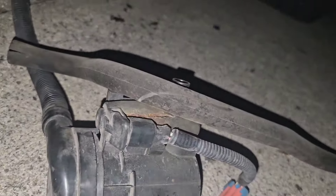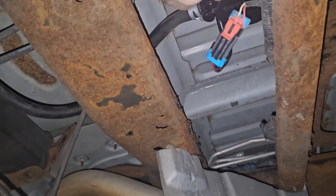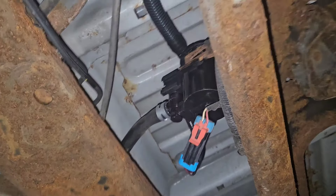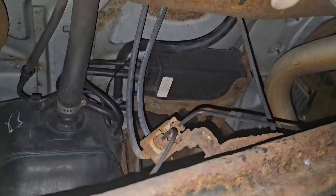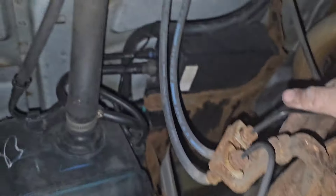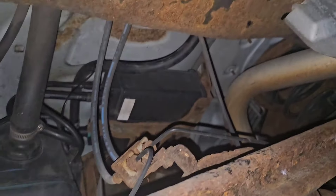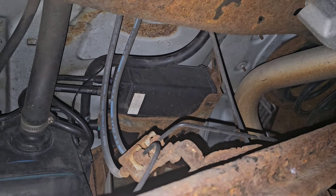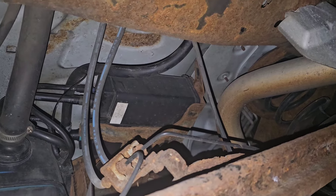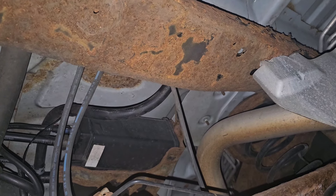This whole unit needed to go, and I found a super cheap one on Amazon. It goes right here, and then there's a vent tube right here that goes up by that filler neck up in the corner, and then the other line snaps in back there where that blue connector is. That was my other source of the EVAP leak — leaking slowly around those cracks. I'm surprised the vent valve was even working anymore. But we got a new one in and now we have no more codes in the computer.